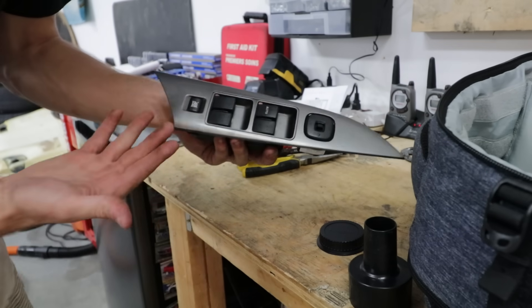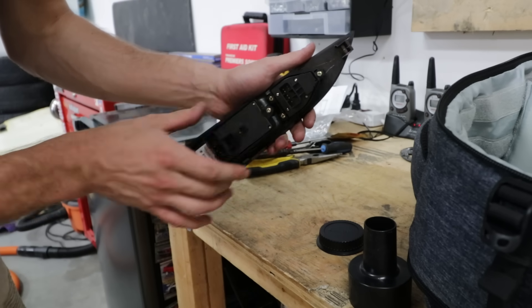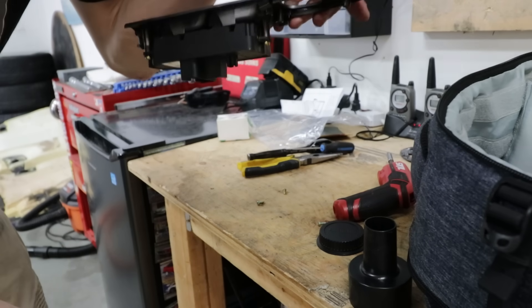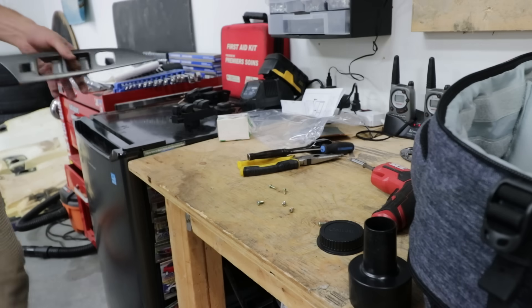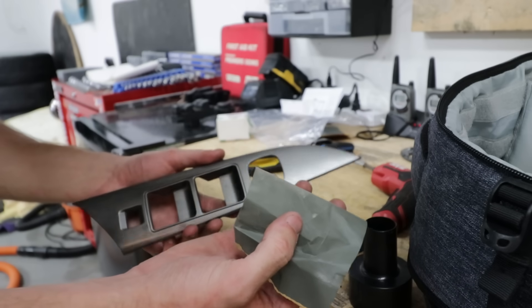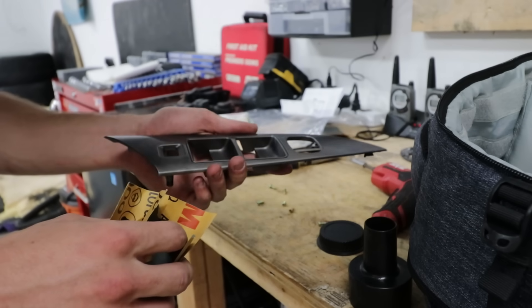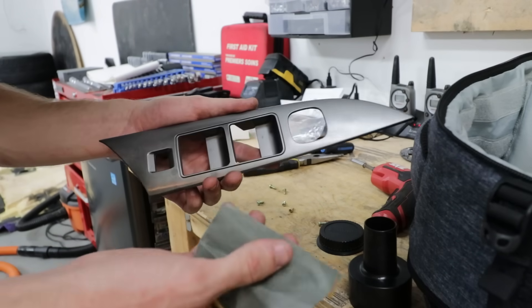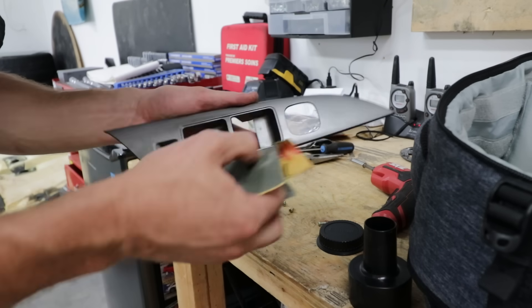So taking a look at the piece we removed — there's one big switch. Looking at the back, there are three screws for this module and three screws for the window switch module, and it just comes apart like this. With the old panel piece, we're gonna run this up just like last time when we did the steering wheel accents. We're using 2,000 grit sandpaper — I'd definitely suggest 1,000 or 1,500; 2,000 is a little too light. Since this is a high-volume area for your fingers, grease builds up, so we're going to sand it down and scuff it.